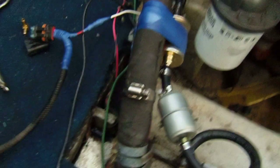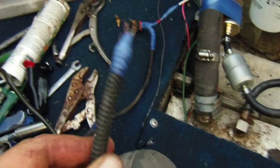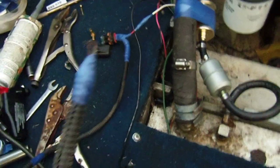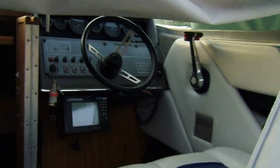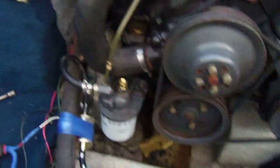Last but not least, I've got to hook up my positive line. I protect it with the housing. What you've got to do is find somewhere on the engine where you get power only when the ignition is on. You've got solenoids up in here - find the one for the ignition; when you turn the ignition on a solenoid comes on and you'll get a good solid positive right off of there. If you can't figure it out, just run a line from your battery, run it up to the front of your boat, and put a switch up there.